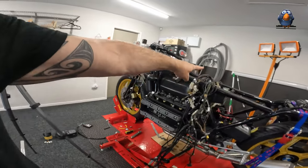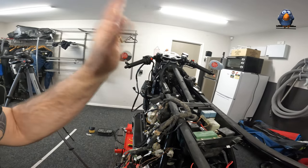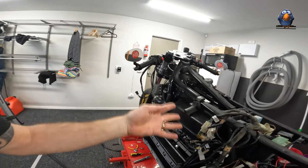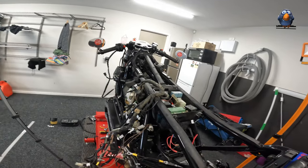The other option is the Motor Gadget Blue unit, or M Unit Blue, or just M Unit. That box replaces all of this - your entire box of relays and stuff - you basically chuck away everything except for the fuel and ignition wiring and you save a lot of space. So that would be ideal.